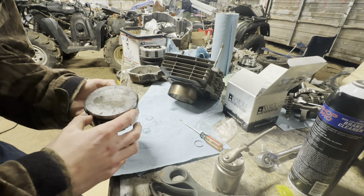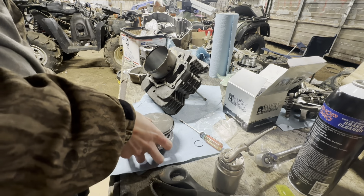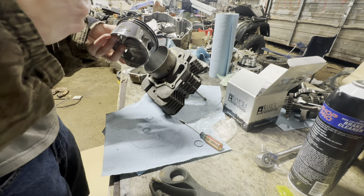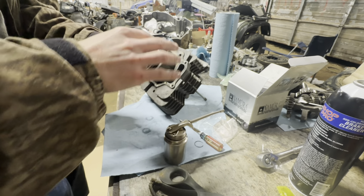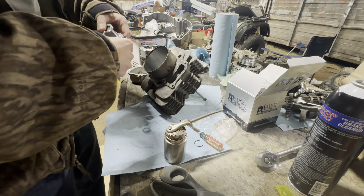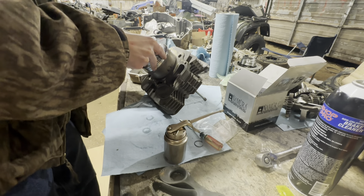Rings oriented — words up, top ring, shiny ring. Put a little bit of oil on the rings and the skirt, lube that up. A little bit of oil on everything — not trying to take a bath in oil, but something to stop the piston from dry starting. When all ring gaps are right, look at your cylinder — exhaust is going to be that way, so they'll go in like this. Just make sure you know for a fact which way is intake and exhaust, because if not you'll be taking it all back off, and that's not fun.